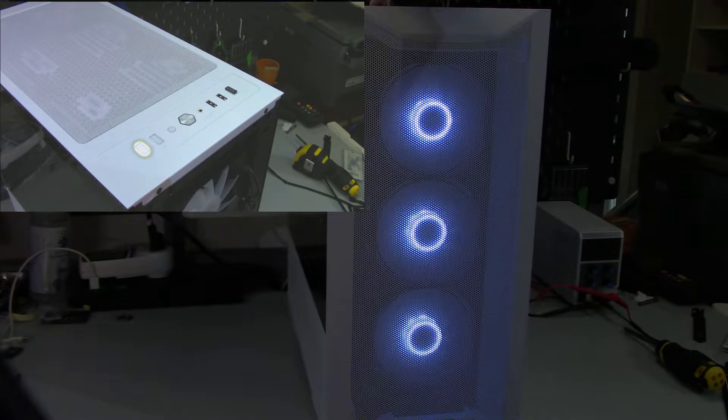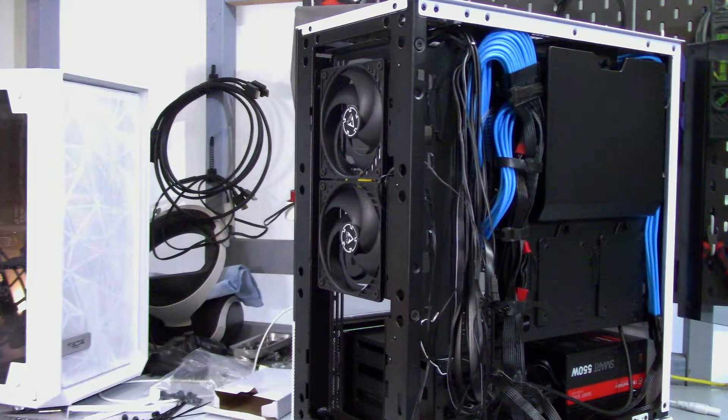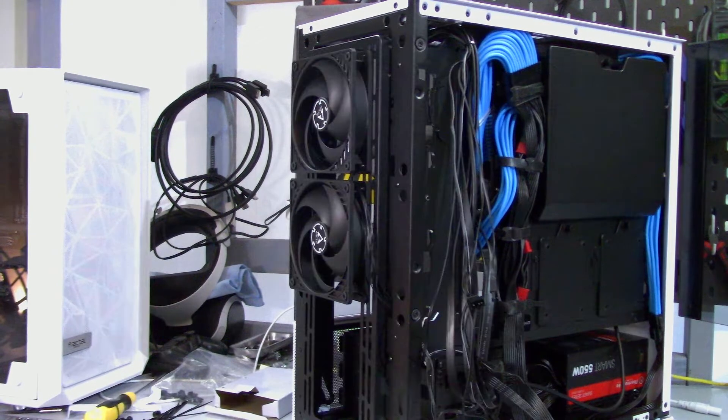The hub has two buttons: the color button cycles through seven static colors, and the lighting effects button cycles through seven lighting effects, with the eighth setting turning the LEDs off or syncing the hub with the motherboard. To use motherboard sync, plug in the 3-pin 5V connector and install the board manufacturer's LED software. If synced, you can turn off LEDs by holding the lighting effects button for three seconds, and hold again for three seconds to turn them back on. The fan tray at the front is adjustable, and I also noticed the rubber pads on the feet were leaving marks on my desk, which do come off but shouldn't be happening in 2021.